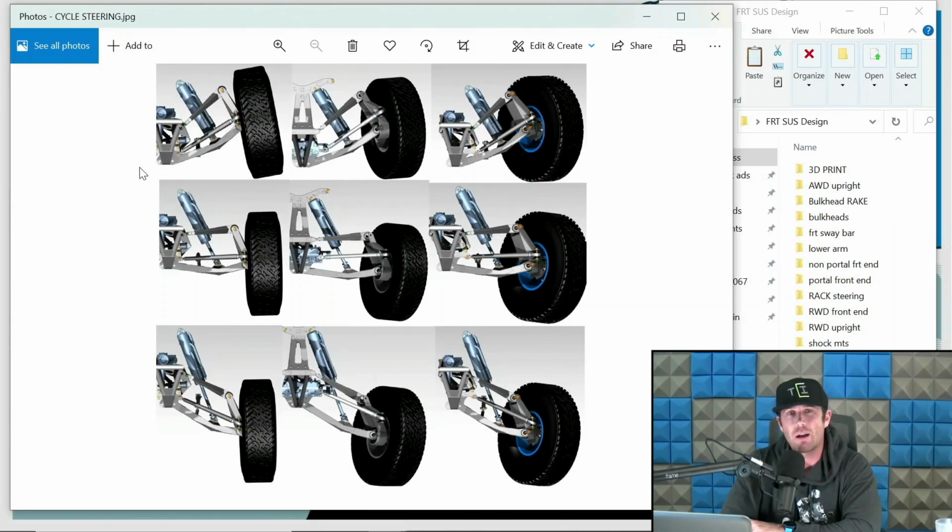And they shouldn't really be that close. There should be some space and a buffer zone between them. And we'll get into more specifics on that in the shock section. But I want you to understand the terms. Usable wheel travel means the wheel travel is actually being used. So that'll be bumped and strapped wheel travel controlled properly by the shocks.